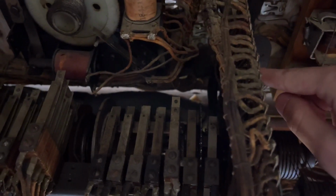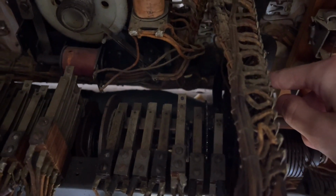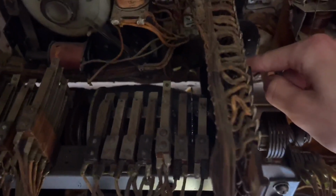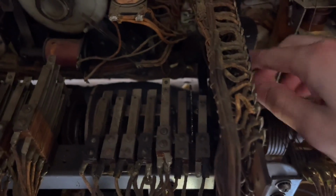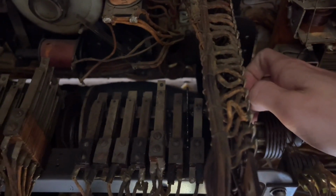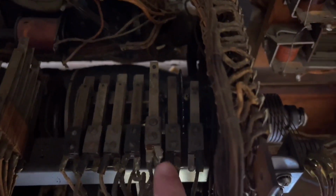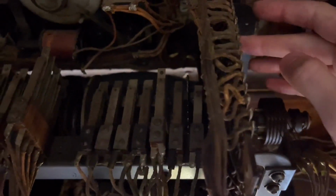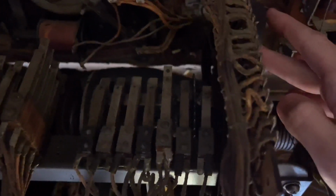that is one of the advance switches. So when that closes, it advances the score multiplier unit. So I'm going to keep rotating it, and it's going to probably do that again. There's another one. We're going to wait for this switch to activate because this is the reset switch for the score multiplier unit. So I'm going to keep rotating it until we get that switch to do its thing.